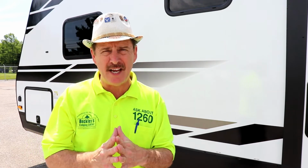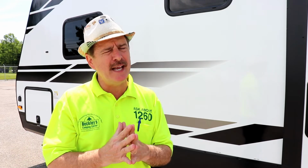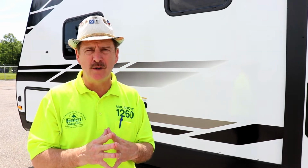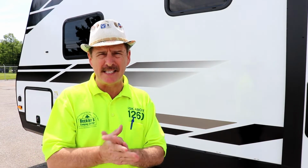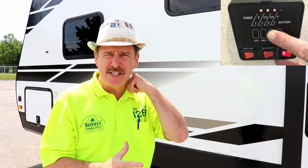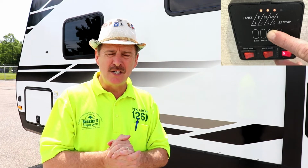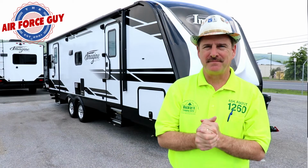Do not do like some people tell you to do and time it. The problem with timing it is this: if you time it and let's say the water pressure is low and it takes a long time, the next time you do it, you may overfill your tank because the water pressure is higher. Now I know you're probably going to use a water pressure regulator, but that regulates it to somewhere between 40 to 50 psi. But let's say you only have 20 psi, when you time it, that's going to create a problem if you're at 40 psi. So my recommendation is that you go inside and stand there where you're going to check the levels of your tank to make sure that you're on target, and when it's 2/3 full, come on out here and empty it.